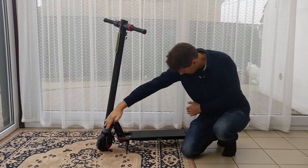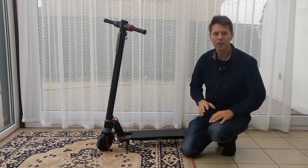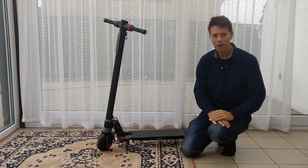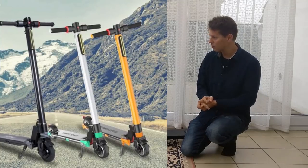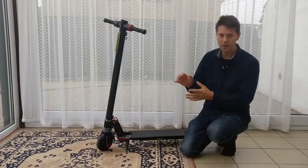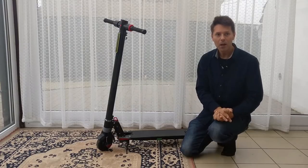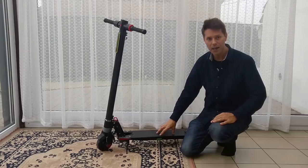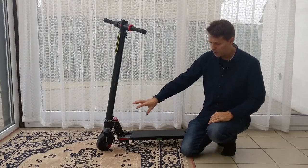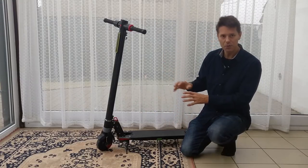The deck length from front to back is about 96 centimeters. The scooter is currently only available in black, with white and orange possibly coming as supplemental colors. The weight is about 11.5 kilograms, about 3 kilos more than the S3 model, due to the extra batteries — about 40 18650 cells under the deck instead of 28 in the S3 — and because of the two motors.